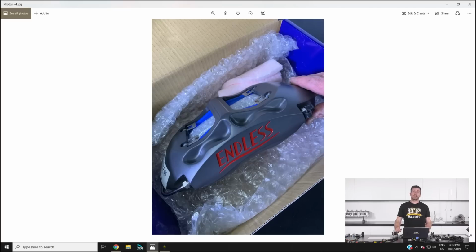So as I say, the braking wasn't a problem, but what we were having issues with was our outer CVs getting exceptionally hot, to the point the grease was melting through the CV boots, and we were having failures with the outer CVs. So one of the theories that we worked on, and this is just a theory, was that we were putting a lot of heat, obviously 550 C, going into the hub through that one-piece brake rotor, and there it's going to end up getting transferred to the outer CV as well.